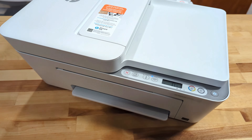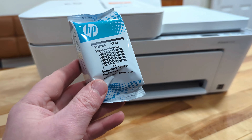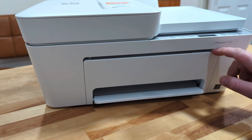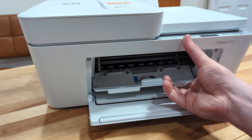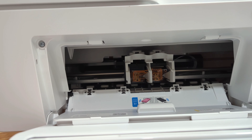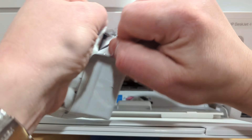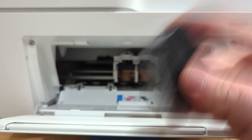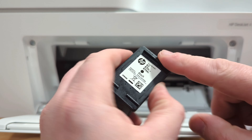So it's time we put some ink in. The first step in changing the ink on your printer is to go ahead and make sure that you've got the printer powered on and that you have both your black ink cartridge as well as your tri-color cartridge. To install the ink, you'll need to drop down this front cover, and then on the inside you'll see this cover here which we can pull down — the ink cartridge carrier. Go ahead and tear open the black cartridge. Then shake the ink cartridge to make sure that after sitting it's going to be ready to be used.